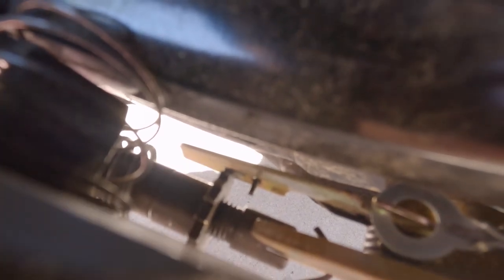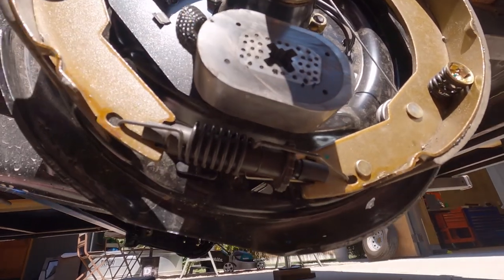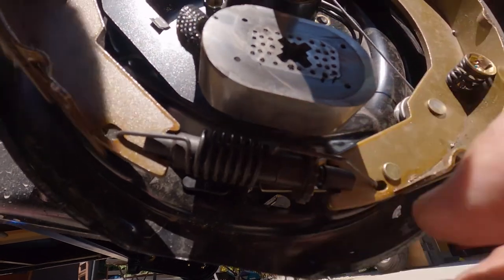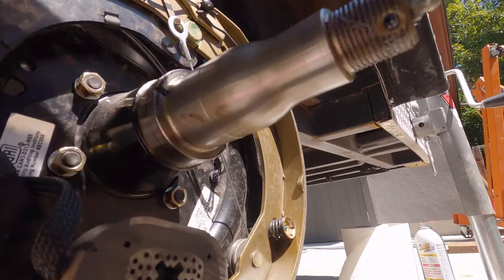...that you don't have to do some adjustment to them at intervals. If you were looking from the back of the backing plate, you come in from the back with your spoon and it adjusts this wheel right here. That wheel is how you adjust the tension between the two braking surfaces — the primary shoe here and the secondary shoe over here. There's also a catching plate on the wheel, and once you engage it just give it a little push — you hear it click. Give it a couple of those and that tightens it, elongating this bolt right here.